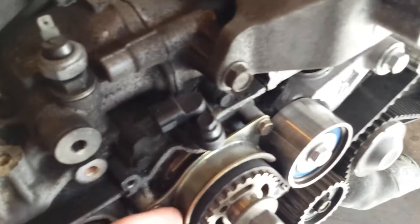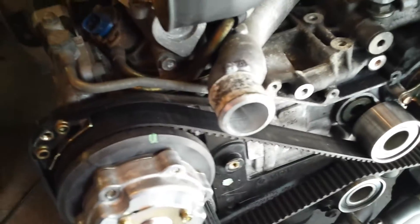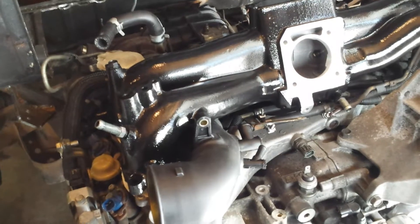That's the AVCS solenoid. Here it is — this is the cam position sensor. Those are VR sensors, as opposed to a hall effect sensor. It's basically like this — this is the crankshaft position sensor, excuse me. So I had to get a signal converter to clean up that analog signal into a digital signal, I think that's what it does. It was expensive enough — it should make me coffee too, but it doesn't unfortunately. So hopefully the wiring will be finished up here shortly.